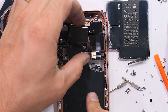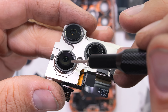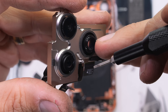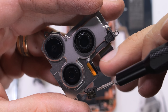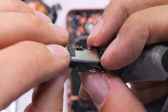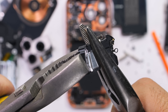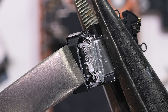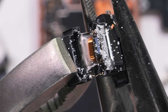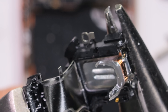The rear facing cameras are all 48 megapixels and tied together in one large housing. Neither the ultrawide, the telephoto, nor the main camera have exterior optical image stabilization, but the main camera and telephoto both have sensor shift stabilization on the inside, which is just as if not more capable than regular OIS — sensor shift is still a physical form of stabilization. The upper loudspeaker looks pretty normal; the iPhone 17 Pro does have stereo speakers, unlike the iPhone Air. It doesn't have any windows to see the balls inside, so we bust it open — and indeed we do find balls inside. These give the speaker's sound waves something to bounce off of so the tiny speaker doesn't sound like a tin can. Balls make little speakers sound bigger and more full than they actually are.